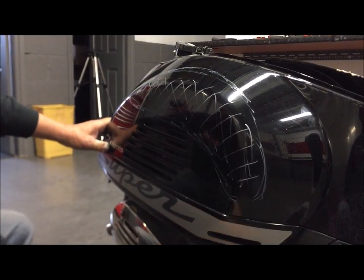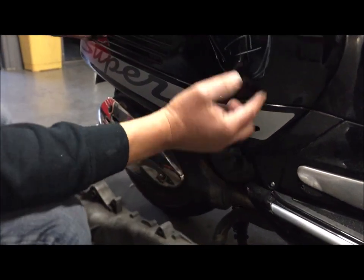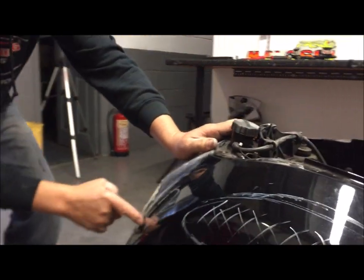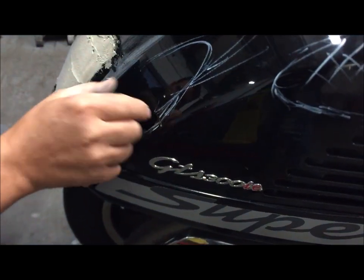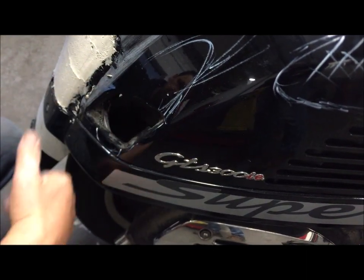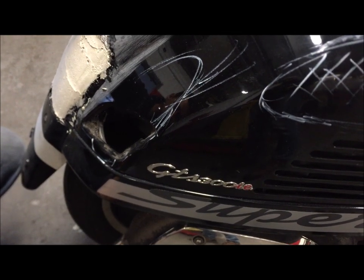The exhaust system will come up here off the two-stroke cylinder, pop up into here, and then you get the fattest part of the system here. And at the back here, this will be plated out, and the muffler will be coming through here. And this oval slot here will allow for the suspension movement to come up and down. So that will be the layout for the exhaust system.